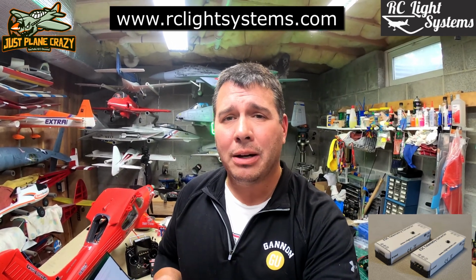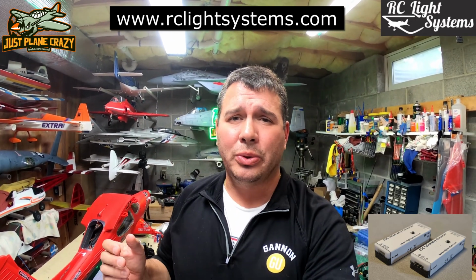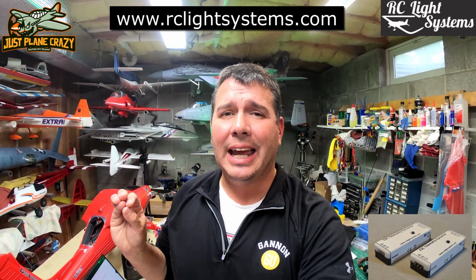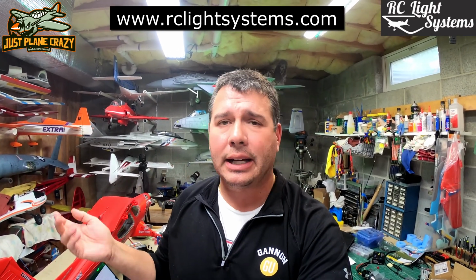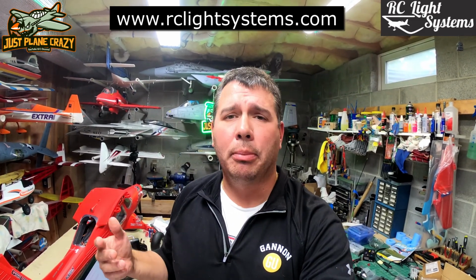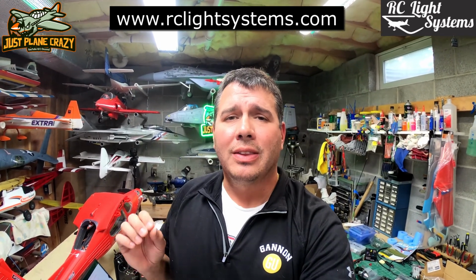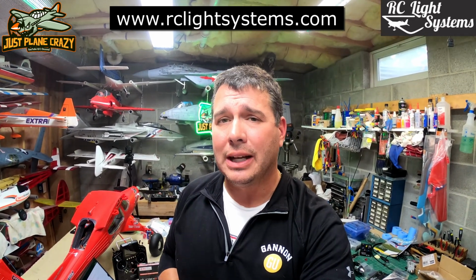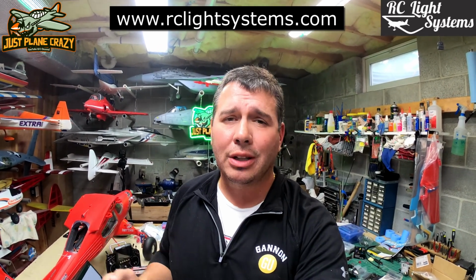Not only will it help you to do that, but for us, a lot of the Eflite products, we have struggled in order to get telemetry over to anything, and there's a cool caveat to this. We have struggled to get any of our telemetry data past a Spektrum radio, NX, DX series, whatever. So you couldn't fly Jeti or JR, Futaba, or anything else with these ESCs without changing them because you couldn't get the data out of them. Well, the other thing was, if you didn't buy into the proprietary battery situation, you also weren't going to get capacity unless you were to put in something like a Jeti MUI current sensor.